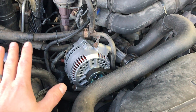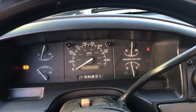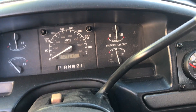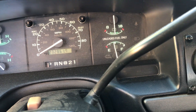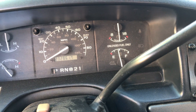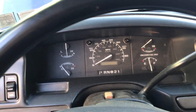We're going to turn the truck on. Previously the voltage needle used to ride between the O and the R when I had the lights, air conditioning, and radio all running at the same time. With only the radio on, we're sitting at the M. I pull on the headlights — still riding the M. Air conditioning on max — we're still on the M but you can see it dipped just a little bit. Turn everything off and it goes right back to M. So even with everything running it dipped slightly, which just shows you what it would do to the 95 amp G3.